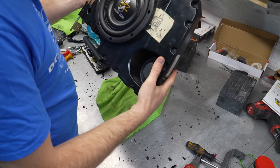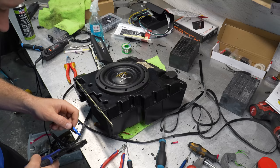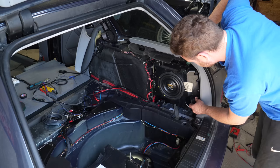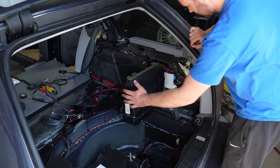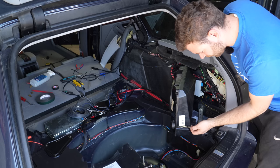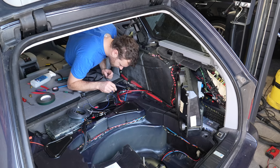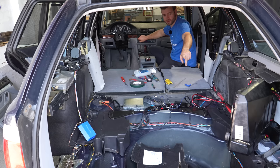Good morning — this dried overnight and it looks good. I removed the excess RTV and I'm pretty happy with that. Now we're going to connect the cables and crimp them. This is going to be the plus. Now we are ready to install this in the car. It goes above the battery, then the cover comes here — you don't see it — and if you need to access the battery you just swing it out of the way. I just looked up on RealOEM and there's a bracket that comes in here, and the screws go into that and hold it in place — I placed an order, it'll come in a couple of days. Hook up the wires — plus to plus, minus to minus. Let's test it and see if it blows up. Yep, that's working!